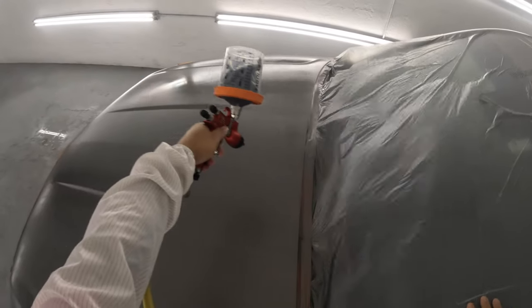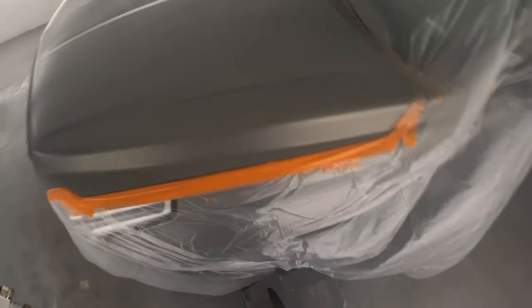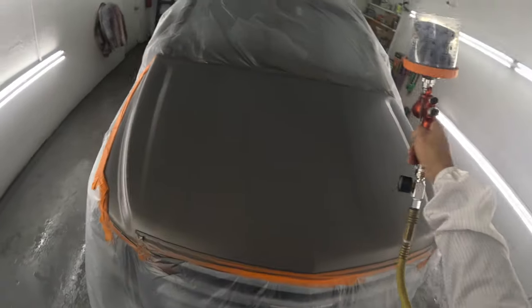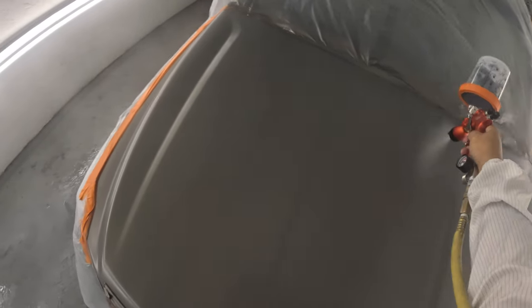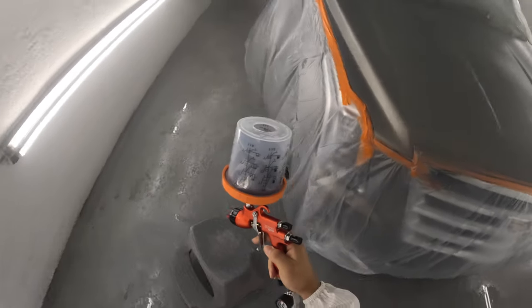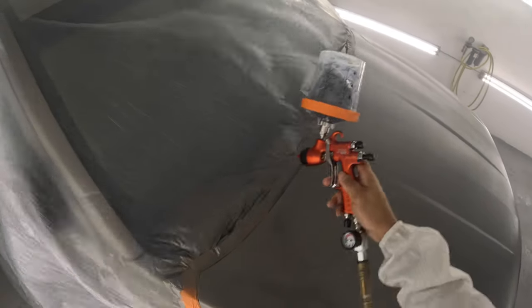And this is a tricky color, so this would be one of those that I would be sitting there trying to match or have to blend. And these colors here, they have a real light flop. Sometimes they're light, sometimes they're dark, sometimes the flop on these is pretty funny. And you'll see that at the end of the video when I show you when it's completed, when I show the video from behind the hood, you'll see the flop. It looks completely different. And that's what I'm saying will throw you off. If you put base down towards the end of that hood, close to that fender, 9 out of 10 times, it won't be right.